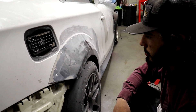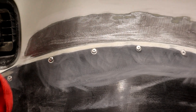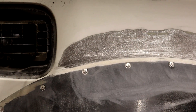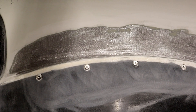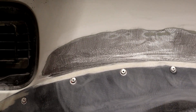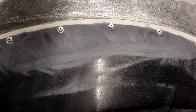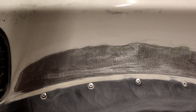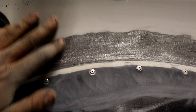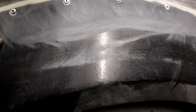To prepare this to go on here, I'm going to be using fiberglass mesh, which is going to fill in the gap and smooth it out. I don't want to use bondo or anything like that for the main molding — I'll be using fiberglass body filler for the final finish on any small imperfections, but for the big transition from here to here I'll be using fiberglass mesh. I'll use fiberglass resin to harden it. For that you have to sand down the fender with 80 grit, and also take the paint off the actual metal with 60 or 80 grit as per the resin instructions.